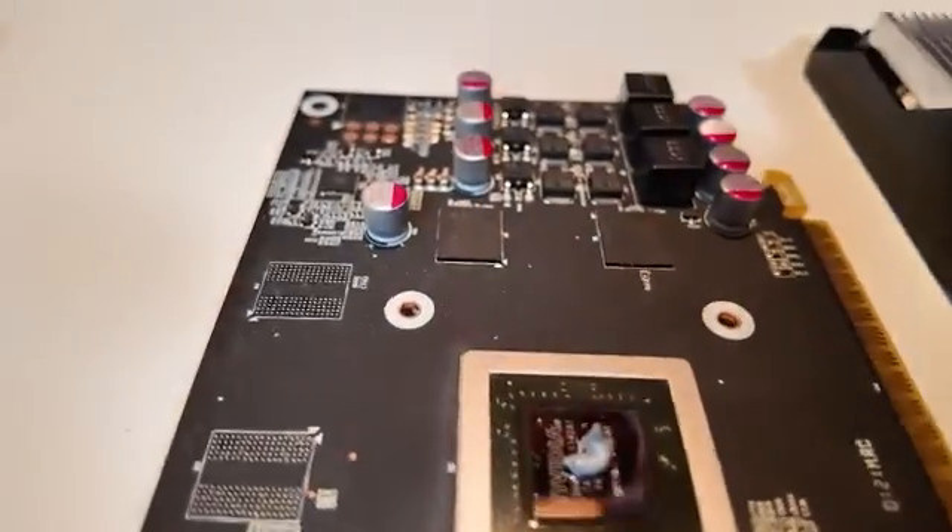There are a couple of other curve balls that Caleb and I will show you as we go. Just like the other one, we're going to take off the four screws. Once you get those screws off you're going to separate the two halves — it shouldn't require much force. This paste is in worse shape than the last one, so we're going to repeat what we did last time, taking the alcohol wipe or just a napkin and wiping off the paste. It's very crusty — you can see all this hair and stuff that just accumulates over the years.